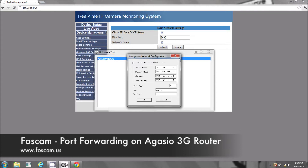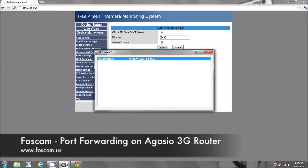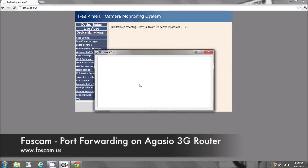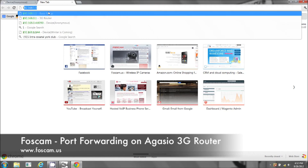Just remember that because your camera should disappear now. Here it says 192.168.0.2 — that's for your camera. It's actually going to change now to colon 8090. That's the two dots right next to your L key; you're going to have to hold shift and press the semicolon, colon, 8090. So long we can log into the router.